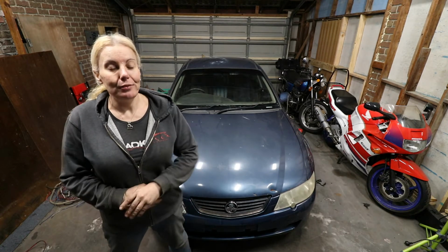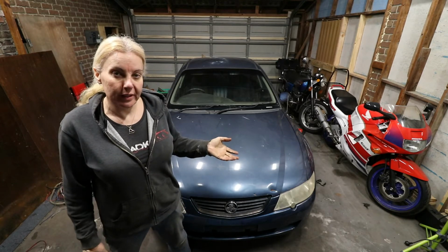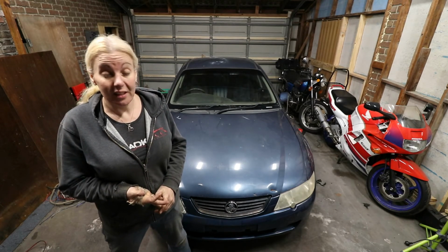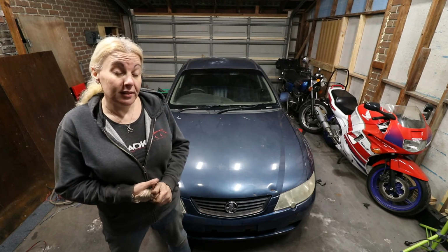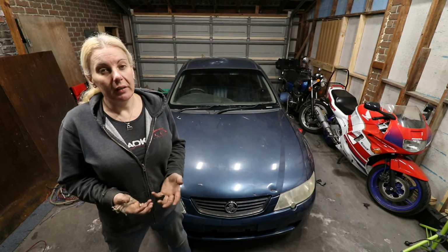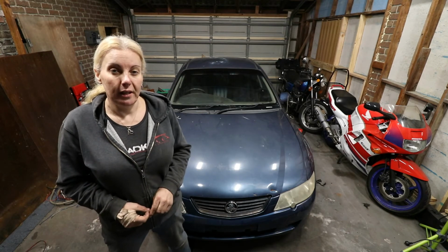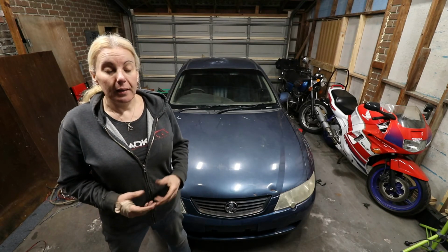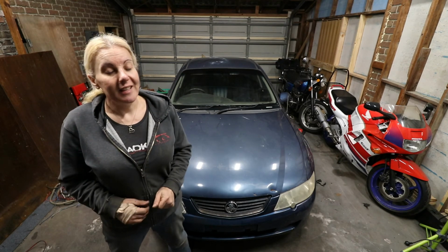Right, so day one, Drift Ute, very exciting, but lots of work. I've removed the additional electrics. There was at least 2 different high-powered stereos installed in this car at some point. Trailer wiring, gas system, all the wires, there's heaps of them, but I've pulled them all out, returned the car back to stock. The only thing that I'm removing beyond that is the airbags, because you don't need airbags in a race car, and I'm not putting any airbags in there, or it's all been removed, the wiring and so forth. So beyond that, it's going to be a little bit of work to get this ready for the track, but that's what we're working on.